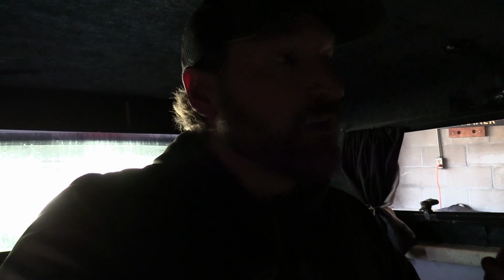But something I like doing, getting in the back of the truck like this and closing everything up, it really helps you find out where all the little air holes are. It really helps with the tailgate. You get back in here and you can really see where the gaps are in your tailgate. Your tailgate is one of the worst spots where dust is going to come in, and you need to seal that up good. Now I'll spin the camera around here and show you what I'm talking about.